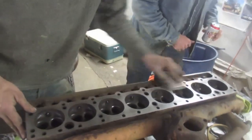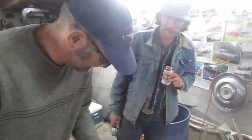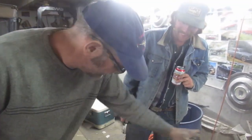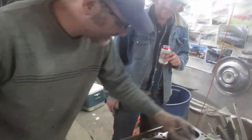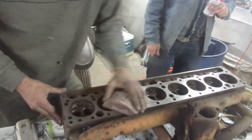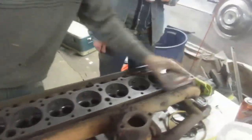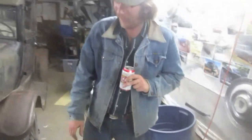They always want to go with the grain of the head. Don't want to do a fine piece of wood. Put some water on it to raise the grain, cut it down one time. Well, that'd be nice. Just shellac it and lay that gasket on there. You're sanding too much in this region. It's going to be low. 10 thou, right. Low. 10 thou.